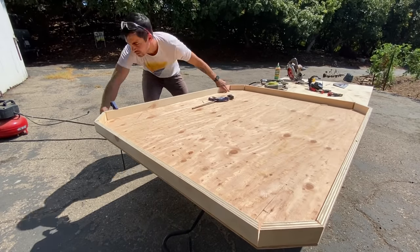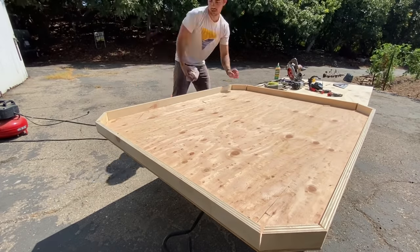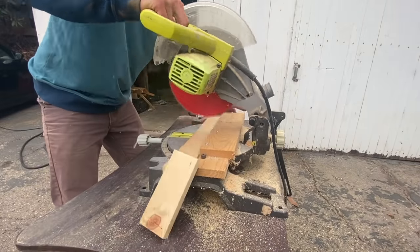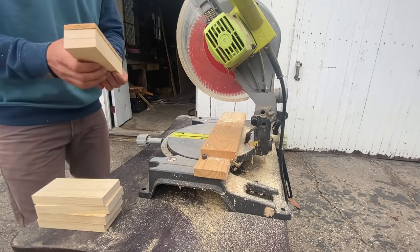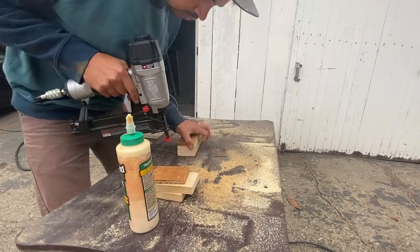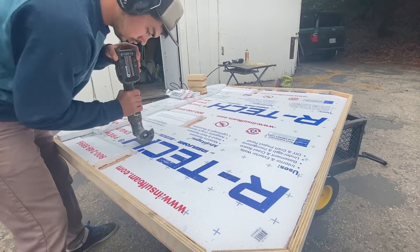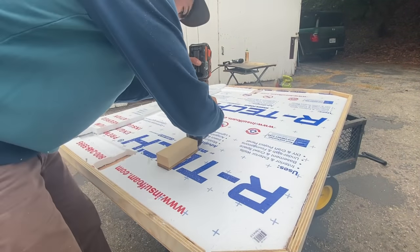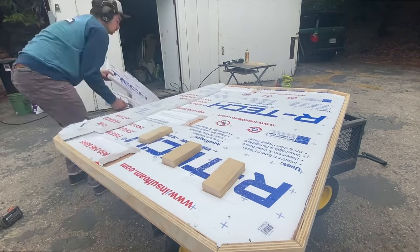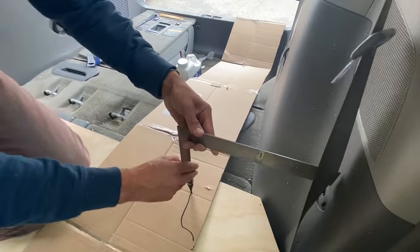All those nails are going to end up getting covered with trim anyway, so I didn't feel too bad about letting them be seen. After I built the subframe, I needed a couple of little supports to go on the inside. The trolleys that held the passenger seats already support the floor pretty well and the foam is fairly high density, but I still wanted to make up some blocks to put strategically through the main unsupported areas of the floor, especially where there was going to be a lot of traffic in and out of the van. One of these spaces was right inside the main door, so I put blocks in there to support the floor and eliminate any bounce.